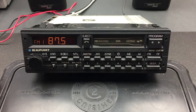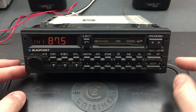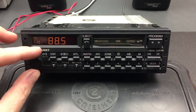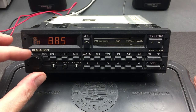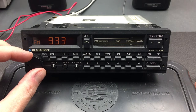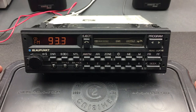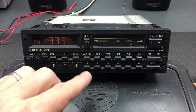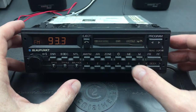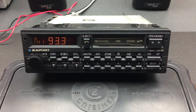Let's look at the radio features. By pressing the seek buttons to the left, the unit seeks in the current frequency — we've defaulted to FM. Press it once and I've immediately found a channel at 88.5; pressing again seeks the next channel. You can store a found station into any one of the six preset buttons. On most modern radios you'd just press and hold a number, but this one uses the memory function: press memory, then press the number you want, and it's stored — for example, FM1 and FM2. Now we can toggle between those presets very easily.